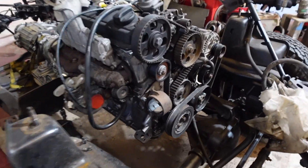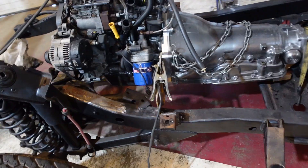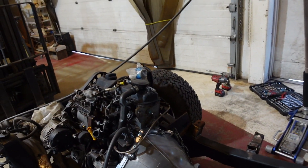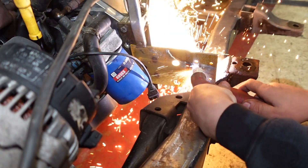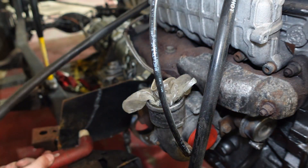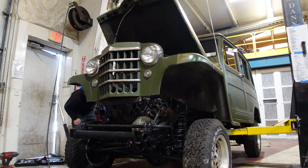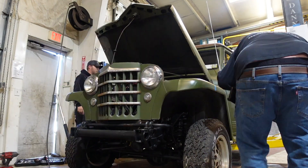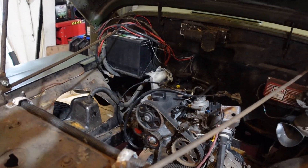We can make some real motor mounts off the front like we were saying. Hopefully those mounts we just made don't interfere with the body. We've got to trim these mounts on either side to be able to fit our Jeep body because the motor mounts are really close to where the body mount is. There's our engine in there — really small. You pop the hood on this thing and you can stand in there. Look how much room you have in front of the motor.